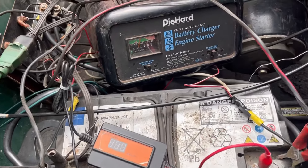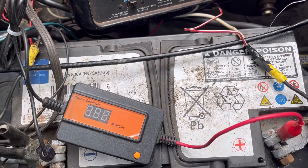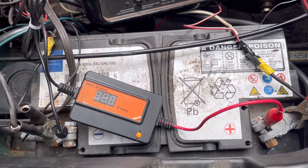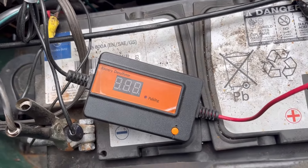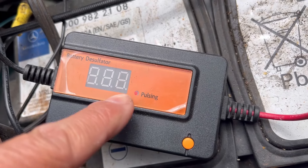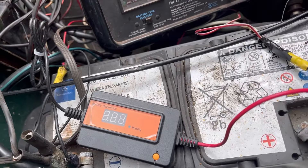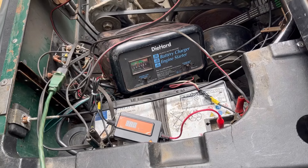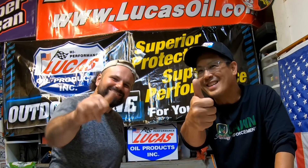So I've plugged it in — it's now charging the dead battery. The multimeter read about 0.07 volts, so this battery is completely done. I'm charging it with the desulfator on here. I've had some pretty good success with the desulfator. It's pulsing, but I think it only really works once the battery is somewhat charged. I'll give you an update on what happens. See you guys next time on Mowers and Blowers.